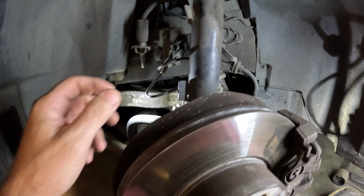And we have a brake light, an ABS light, a service engine soon light. I think that's the dynamic traction control lights that come on. I ran a diagnostic on the car, and it looks like it's going to be the speed sensor on the left front wheel. And we're going to change that out.